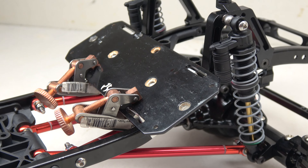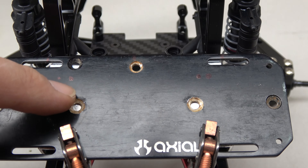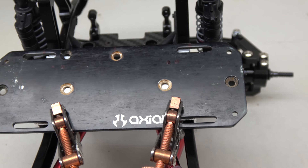For this next step, having a small set of clamps comes in handy once again. We need to attach the battery plate to the angle aluminum pieces we just mounted to the chassis. We do this by drilling four holes in the top of the plate and countersinking them. Normally you want these holes to be nice and in line, but I'm going to use these pre-existing countersunk holes, so my other hole is going to be around here. Make sure that this plate is nice and centered on your chassis.